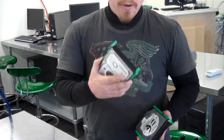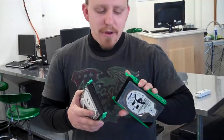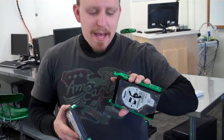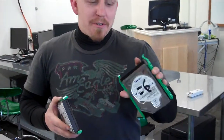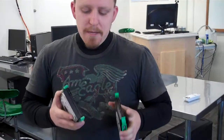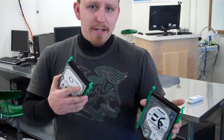As my master, I would boot off this operating system, but I'd still be able to access the data off the other hard drive. This is really helpful if you have a hard drive that gets corrupted or won't boot, or if it has some damage but you think there's still recoverable data. You can set it up in this configuration so you're using one operating system to access data on a different drive.